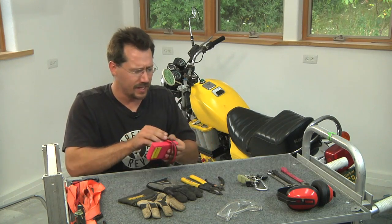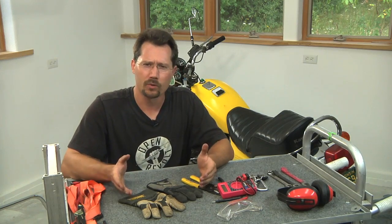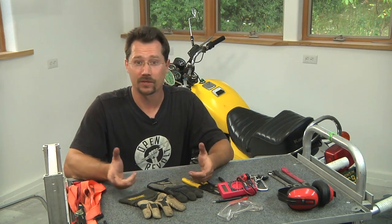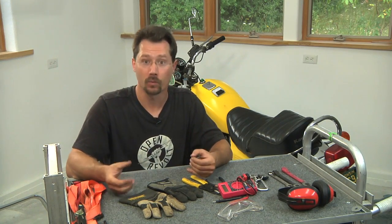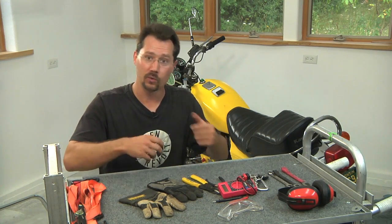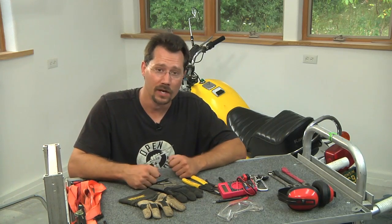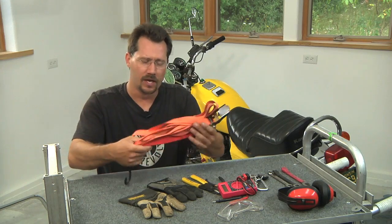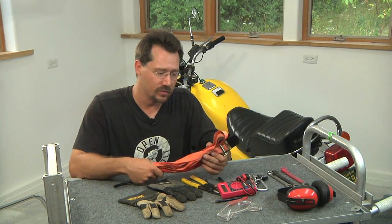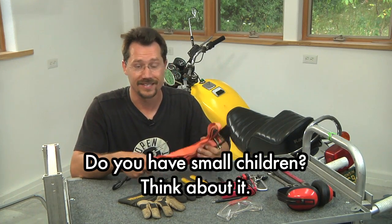Now there are a couple of things of particular interest with an electric motorcycle. You may want to lift your motorcycle up so it's more ergonomic to work on — using a motorcycle lift or a small but sturdy workbench you and a friend could lift it onto. However, a motorcycle could easily tip off, so if you're on any elevated surface make sure to use a ratchet strap or tie-down so the motorcycle won't tip over if the weight shifts.